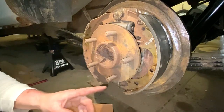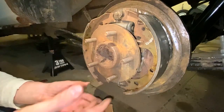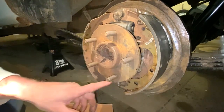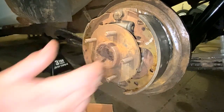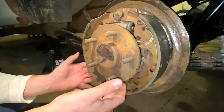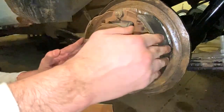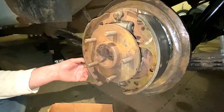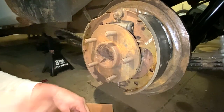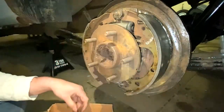So, all right, that's the second step. The first step is to make sure that the thicker side's on the back and the front. I always do it on the floor, making sure that your adjuster and spring are on, like we said earlier. Then putting on the emergency bracket, which is up here for the emergency brake. And then the return spring for the emergency brake goes there. So now we're kind of in place here, but we got to get these attached.